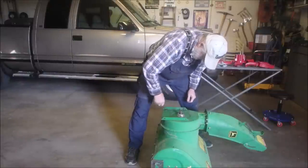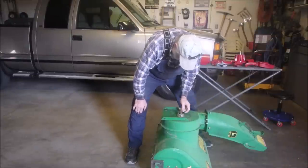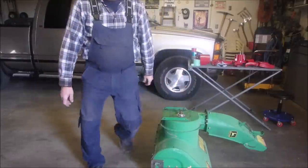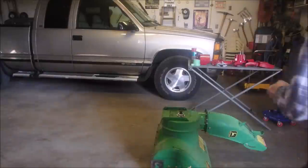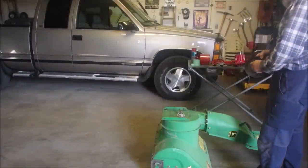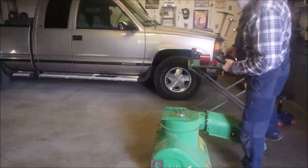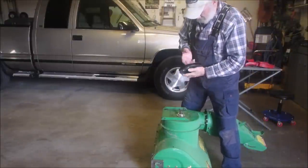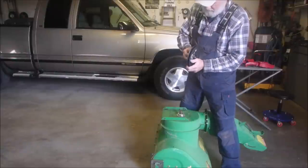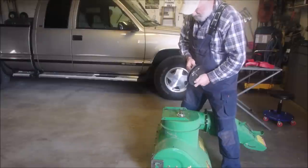Okay, that bearing's good. In fact, it's so good, I think it's new. Okay, let's get our pulley. Even just the arbor part of the pulley, or whatever you want to call it. Now, I think it's going to have to go on like that. Do we have a grub screw in there? Yes, there is a grub screw in there, right on top of the keyway.